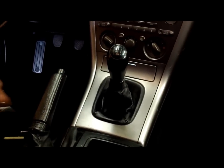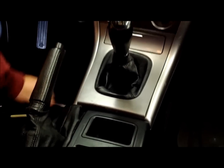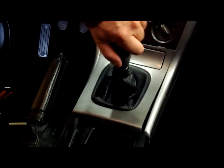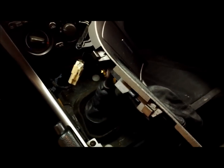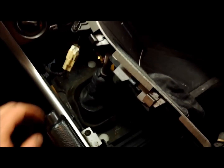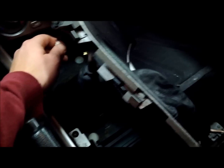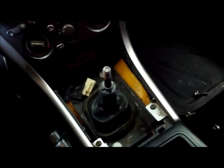First you want to take that flat screwdriver or panel tool and remove the shifter bezel — just pry up on it loosely and pop those little plastic clips up. It should slide back out of the track up top, and then you're going to have to undo the shift knob and remove that part. Once you get the shift knob up you can lift that bezel and flip it up on its side. You'll notice there's one clip here that powers the cigarette lighter, so we need to disconnect that — just squeeze the tab and it should pull that part off. With that we can move it out of the way.